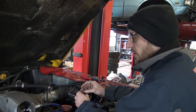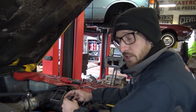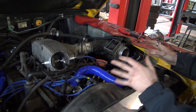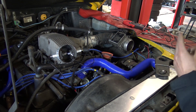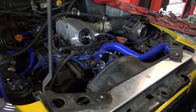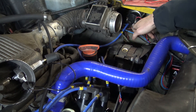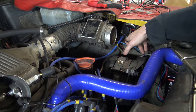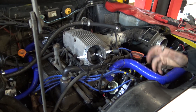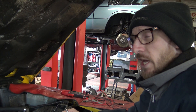Other things to check: we've had customers say the engine starts great but after 10 or 15 minutes the car dies. These tests are more for when your car doesn't start at all. But if your car is dying over time and you're certain it's an ignition fault — you crank it straight away with a spark plug and have no spark until it's cooled down — one thing now these vehicles are getting older is ignition wiring. What's powering the positive side of the coil? Ignition barrels' contacts are getting dirty and not supplying decent power to the coil. One way to check is to run a new cable from the battery to the coil via a switch in the cabin as a new ignition switch. More often than not, that cures the fault and proves there's a fault on the vehicle wiring or ignition barrel.